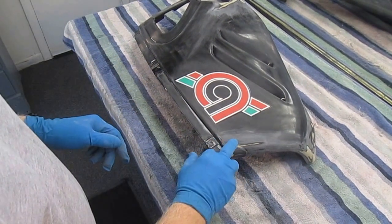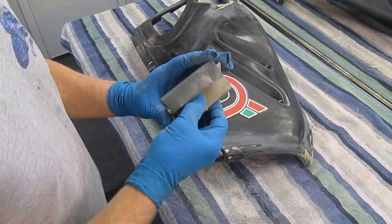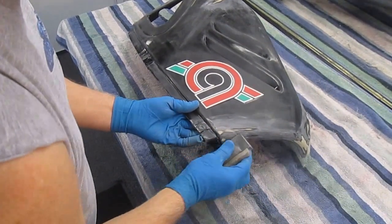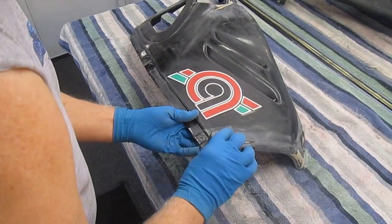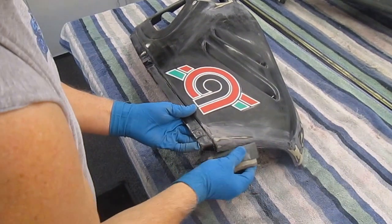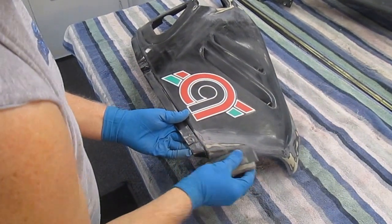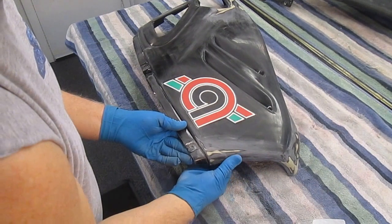It'll build up a little bit of a residue on the outside, but some has already gotten into that crack. Now, an ordinary sanding block, and again, I have to do this for what's going to amount to be a lot of hours of work, and a lot of material, by the way. A job like this, you can use up a lot of this material, and it's, like I said, $10 for 2 ounces, but the good news is that the parts you repair almost never break. I mean, you really have to have some heavy-handed bolt tightening before you're going to break a part that's fixed with carbon fiber and CA. Again, not impossible, but I certainly think you stack the deck.